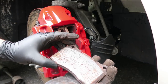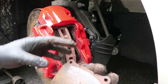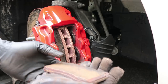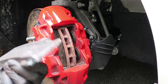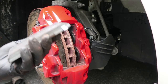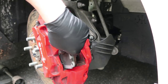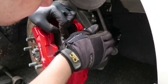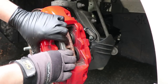The old brake pads still look pretty good — plenty of meat left, surprisingly. This is their sixth track day. They are a little bit harder on the rotors, which is why I'm switching to the Duralast Max pads — they'll be easier on the rotors. I'm saving the OEM pads for another track day. These are the Duralast Max brake pads; they're really good for street driving though not ideal for track days. Note the squealer — you want the squealer on the outside of the car — then place the pad in. Pretty easy.